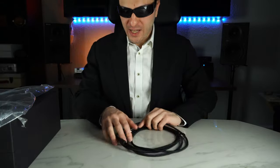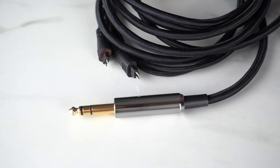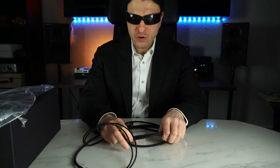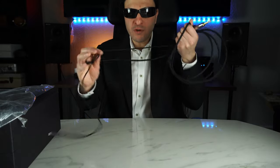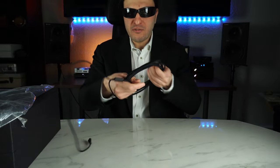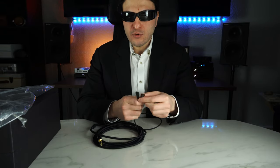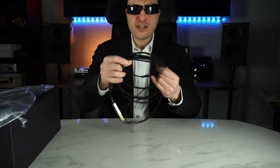Let's explore the cable first. It's a cloth-covered cable with the first hurdle being a two-pin connection very much akin to the Sennheiser line of headphones. But do not plug your Sennheiser cables into this headphone, because they're connected backwards compared to the Sennheisers. You're going to get phasing issues and a lot of problems — you could probably destroy the drivers. It terminates in a very nicely built 6.3 single-ended connection. You can upgrade the cable from Fostex themselves or third parties, but those little adapters will cost roughly $70 to $100 and will have to be exclusively bought to create your custom cable.